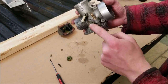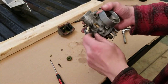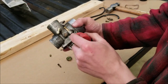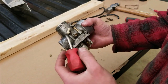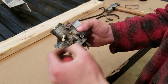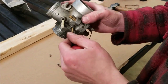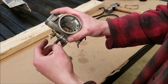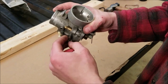Do the same thing with your idle screw. What this does is when your slide is in the carb it'll raise and lower it, determining how much air gets in. This is actually a twin carb engine — it's on a Ski-Doo 380. I noticed it's pretty much pointing towards this side, so if you can find a reference point on the carb it'll help you later. If you're putting carbs together without knowing their original setting, put the slide all the way down, turn the screw in until you just barely see the slide move up, and set them evenly — then go from there.